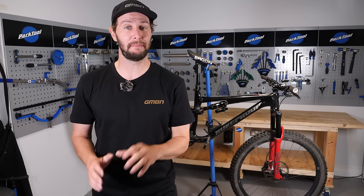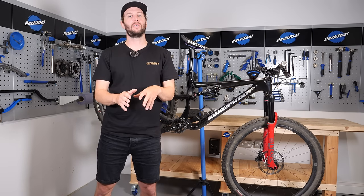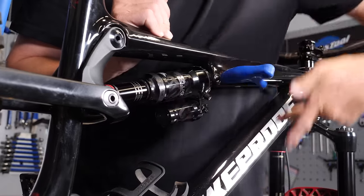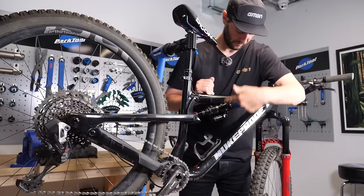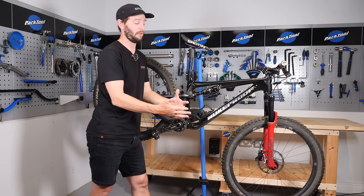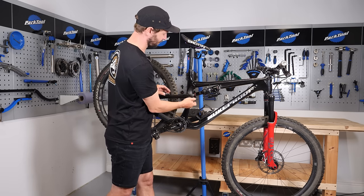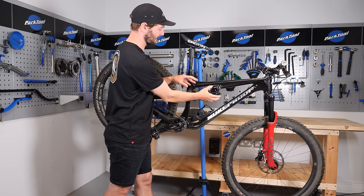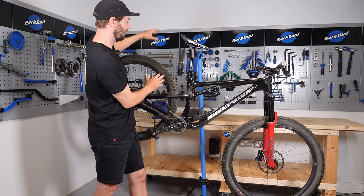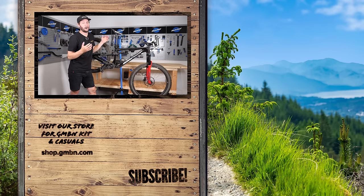Now that your bike's in the stand, you'll find that maintenance jobs have become much easier. You can move around the bike to access the gears, brake calipers, cranks, and cockpit easily. The wheels spin freely, making it easy to check rotors for rubbing as well. If you are performing more in-depth maintenance on your frame — things like replacing bushings and bearings and taking the shock out — this is also where the stand is going to come really into its own. If you had the bike standing on the floor leaning against the wall and you take the shock out, it falls over and bits go everywhere. Whereas now, I could take that shock out, the frame's not going to get damaged, and I can carefully lay all the little linkage bolts and bushings to the side, ready to go back in.